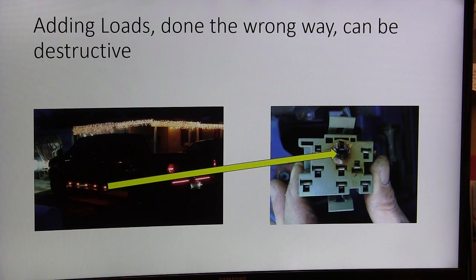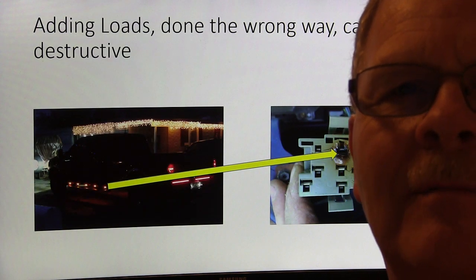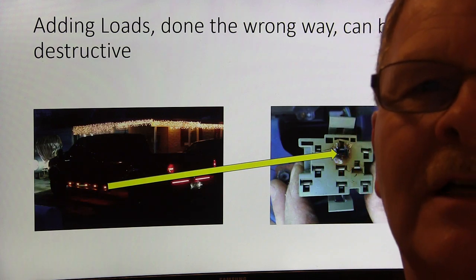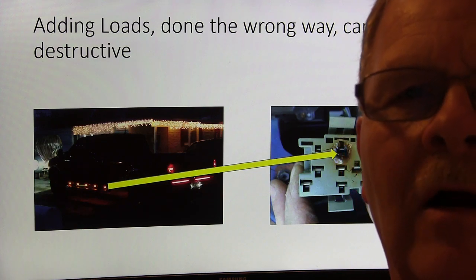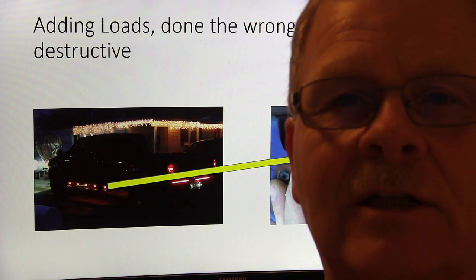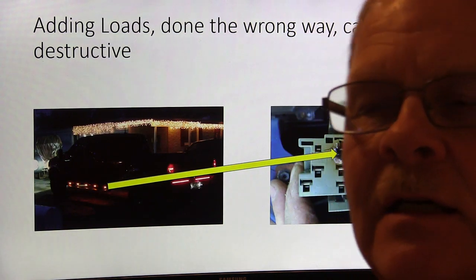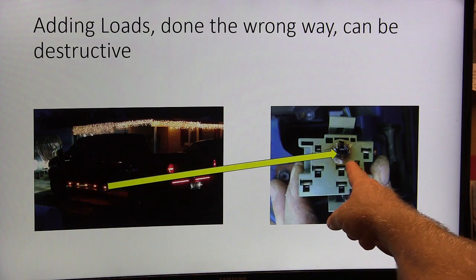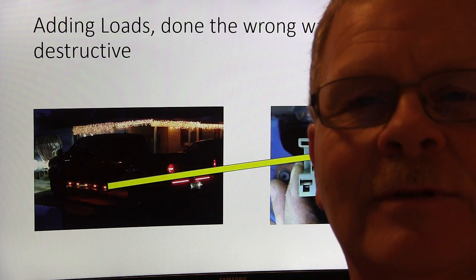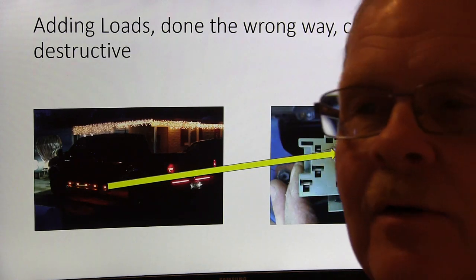Adding loads — I've seen this on Ford pickup trucks when I was working at a Ford dealership. People would add cab lights or running board lights and just find that brown wire under the truck and scotch lock into it. It's going to find the weakest link in the chain — if that happens to be the wire, the wire is going to melt. In these cases on the pickup trucks, what I'd usually see was a burned-out headlight switch. The one going out to those lights would cook the switch, and then you'd have to put a new pigtail and a new headlight switch in.